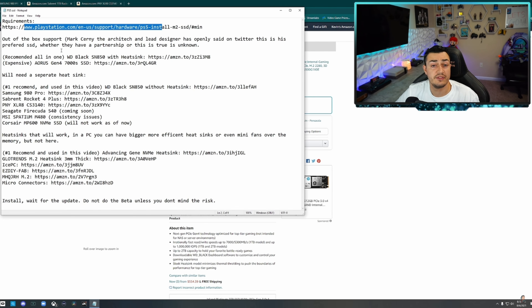Anytime you're going to be disconnecting your PlayStation 5 from power, you need to go ahead and shut it down completely - not rest mode, you don't want to put it into standby or sleep mode. Fully cut the juice off. Step one: you want to go ahead and remove the side stand - it is just held on by friction if you are mounted horizontally. However if you are vertical, you do have a screw on the bottom which screws right into the tuchus of the console.